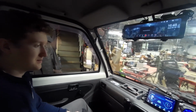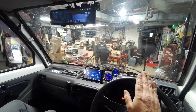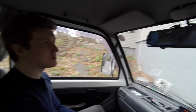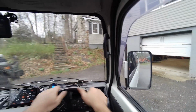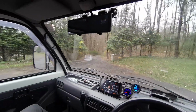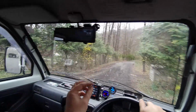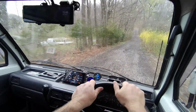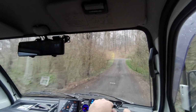Better. Way better. Sometimes it's like 30 seconds long. Because I put a little pressure on my foot and I don't want to give it a lot of gas, so then I give it a little more and then it starts. So the rear end, that flange felt tight. And I know there's supposed to be a little bit of preload, but I've never felt one so tight. That's what he said. Some have a crush collar that you got to tighten it down until you get a certain amount of preload. Some of them have shims that you got to keep shimming them out until you get the right tension, you know, because you got to have a little bit of preload, but not like something that takes quite a bit. And then I could see whether there's air in the tank when I get back with those hoses disconnected.